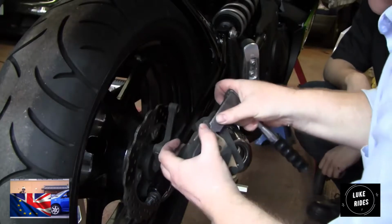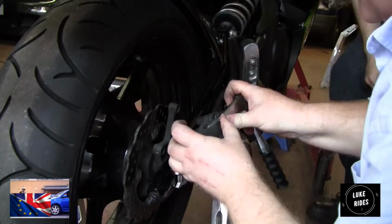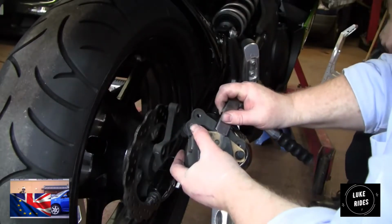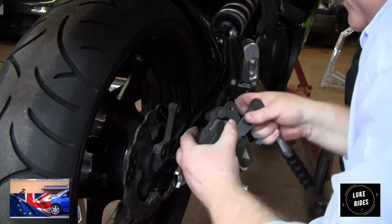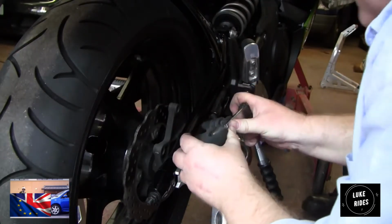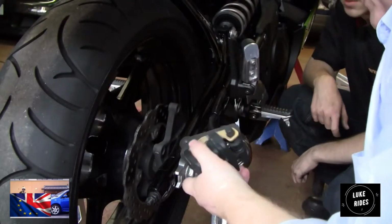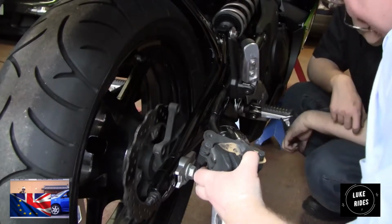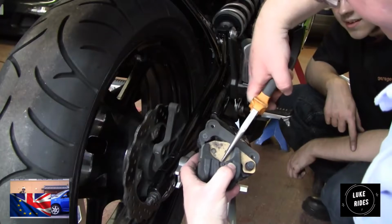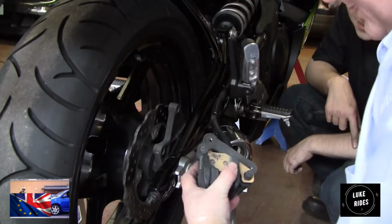Brake fluid is going to come out the top of that reservoir, whether I like it or not, or at least get to the top of the reservoir. A really big common mistake people make when working on any vehicle is to top up the brake fluid. You're not doing yourself any favours. As the brake fluid goes down, it very clearly shows the wear on your braking system. So I'm just going to pull the R clip out. Take your R clip out somewhere you can find it.